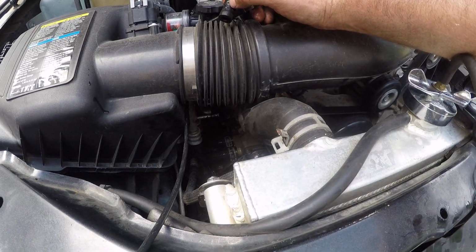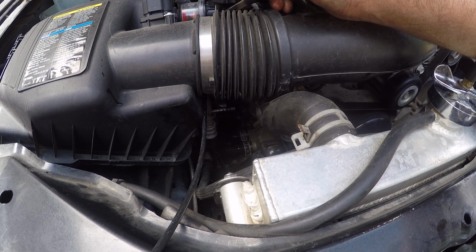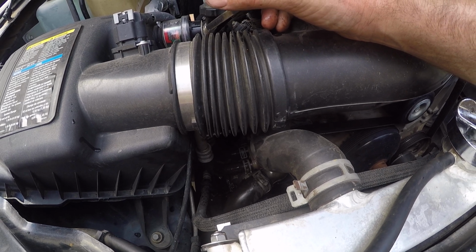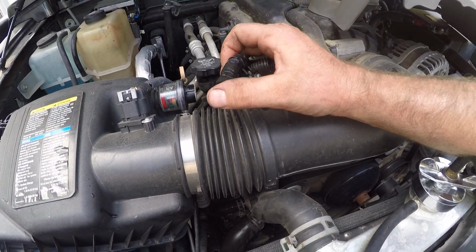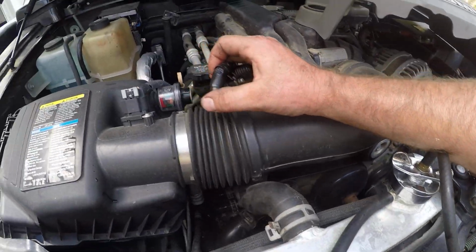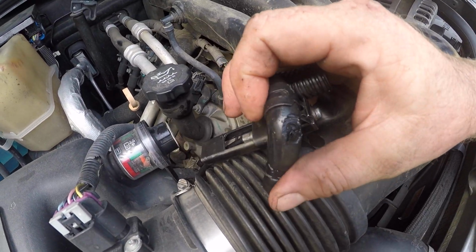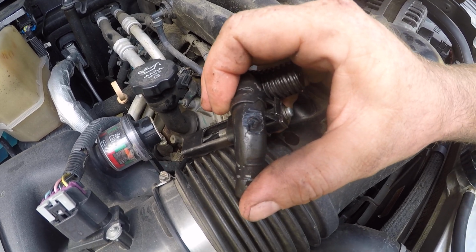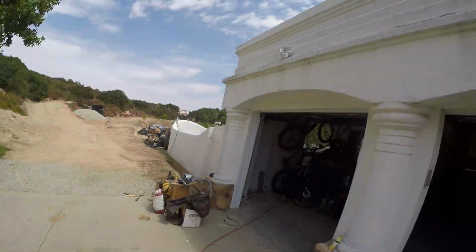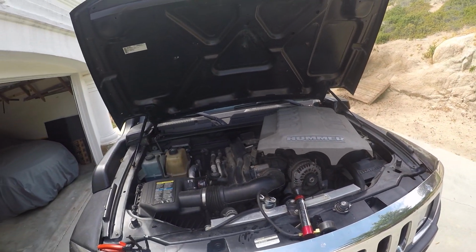Normally, I would be looking for rubs, inspecting for things that might have hit, may have scraped, maybe the belt, a spinning pulley, an accessory, some type of rub. Now this vehicle is kind of stock, but this hose and its location is totally stock. This is not an aftermarket intake. This is kind of weird, and where it was, nothing can touch that. Those little scratchy looking things, that's mouse teeth. Looking at the surroundings, I'm in their territory, so they chewed my hose. I hate them. And yet, I'm just going to fix it.